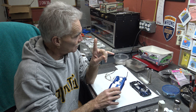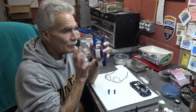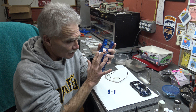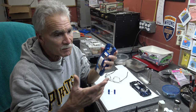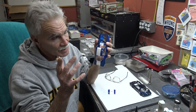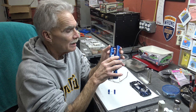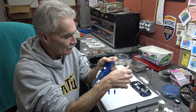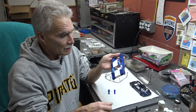Once again — and I think I might have missed something. When you go and you tape it off for your secondary color, make sure that you burnish it all down tight and look at it. Make sure you don't want to splash a paint job — it happens. It's practice, experience, the whole nine yards. When you have finished taping it off, take it out and hit it with a blast of compressed air, because you've been handling it. You've got little chunks of skin coming off while you're working, so you've got to blast it off. Then you run your secondary color.